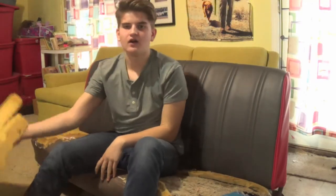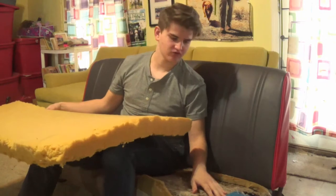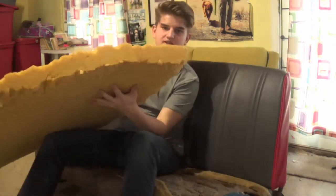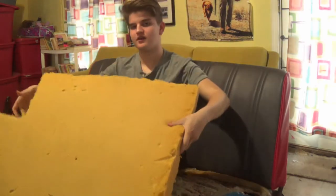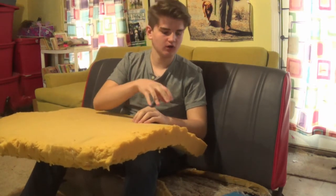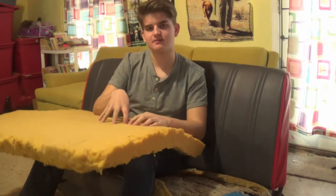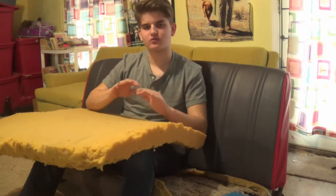So this next part is going to be a little bit of a challenge, but it's pretty simple. I got this chunk of foam here and we just need to cut it out to make it fit and patch right into the spot. This foam's pretty thick compared to the other stuff, so I'm going to have to carve it a little bit through the middle, but it should do the job. One important thing to notice — you want to make sure that the foam on the old seat and your new foam is the same consistency. Because you don't want some foam that's really firm and then the rest of the seat is extremely soft, because then you'll feel that. So you want something that's about the right consistency so that when you sit on it, you won't feel anything at all.